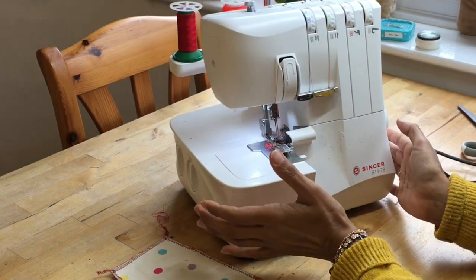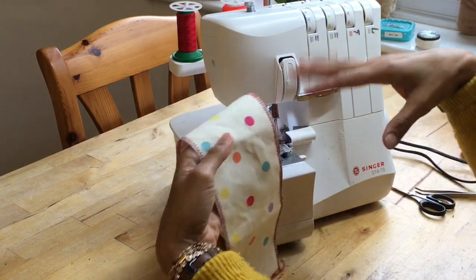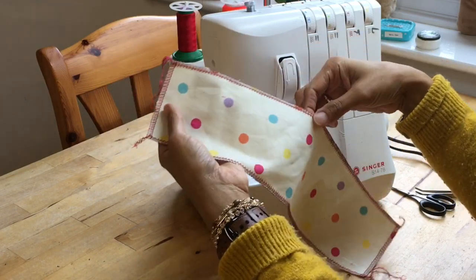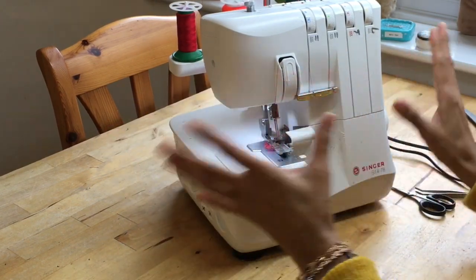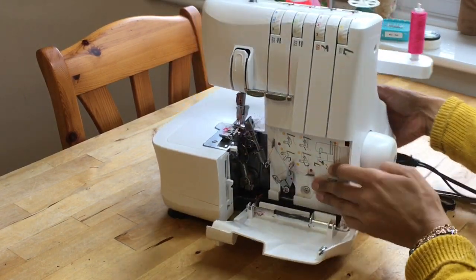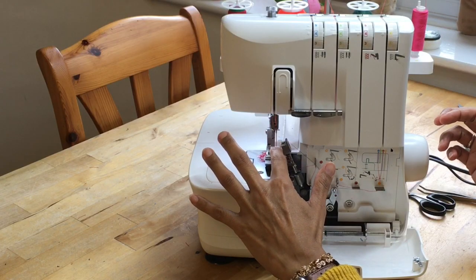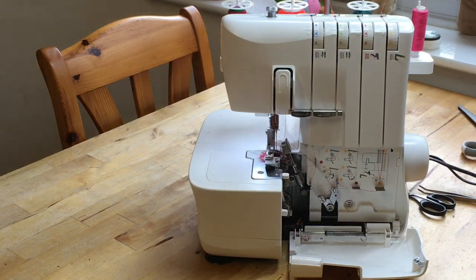I've had this overlocker for not quite a month and it's acting up - everything is on factory settings as it came out of the box, but on a sheet of cotton I'm noticing irregular stitches. The needles are good and I replace them regularly. There are a lot of reasons for this, and the first is I've allowed the machine to build up a collection of fluff inside, which is no good. It dries up all the moving parts and you'll hear a thudding noise as the needles try to force through fabric.